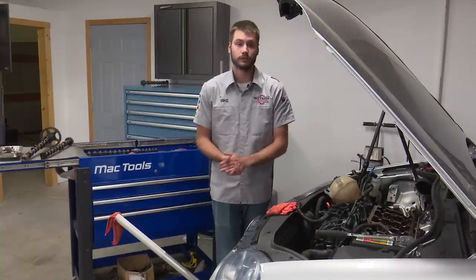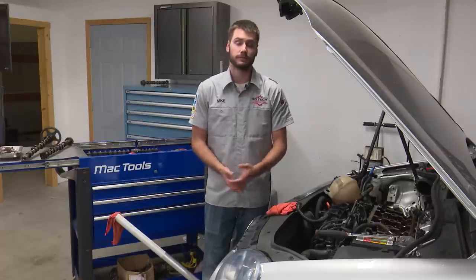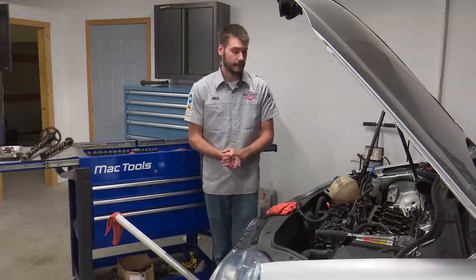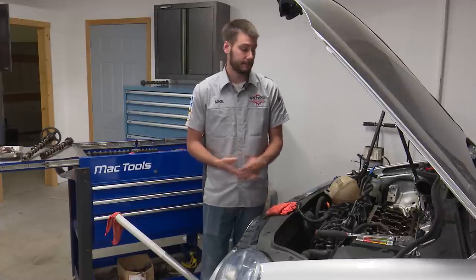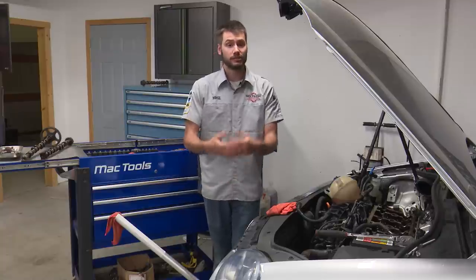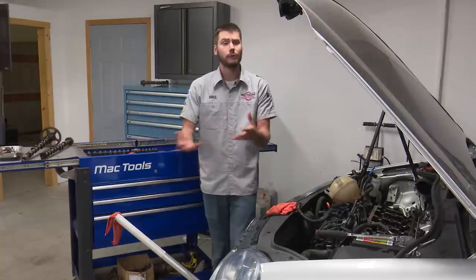Luckily, Diamond Auto Parts was willing to help me out, take care of me, and get me a new engine. There's a link below to their website - they do ship nationwide. If you're looking for used parts, this is a one-off; this is not something they intentionally sold me that's bad. Things happen when dealing with used parts, and unfortunately they were willing to take care of me and really help me out - I can't say thank you enough to them. I'd be interested to know your thoughts - would you have put a new intake cam in this and put it all back together if this was a customer car? If this were your own car, how would you treat this situation? On a customer car I wouldn't have tried the high-pressure fuel pump the first time without suggesting the camshaft and follower up front. Being that it was my own car, it made sense to try it because I had what was assumed to be a known good part on the old engine.